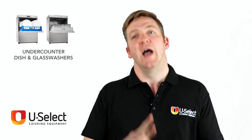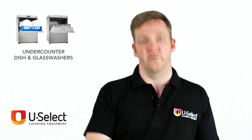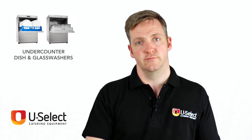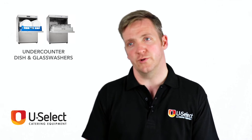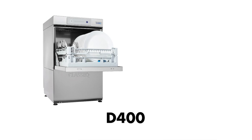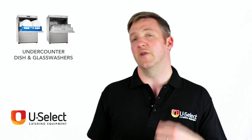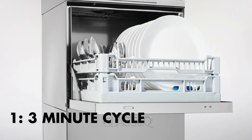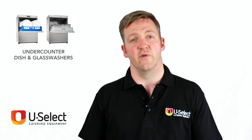The other thing to remember is they don't come with a drain pump. The standard uses gravity to let water flow, and water only flows downhill. So if your drain is above the level that the drain comes out of the dishwasher, you actually need something to pump it back up and into the drain. The standard also does two dishwashers — not a 350, but they do a 400mm and a 500mm for dishwashing. The dishwashers have only one cycle: three minutes, rather than the two minutes of the glass washer, but again very dependable and very hard wearing.